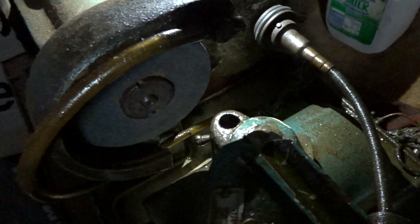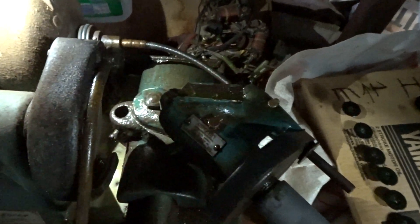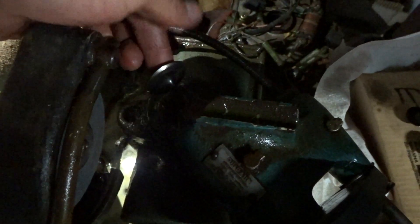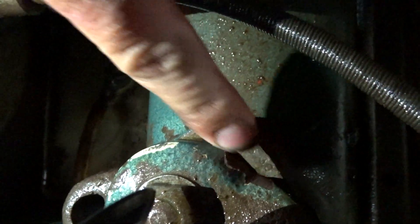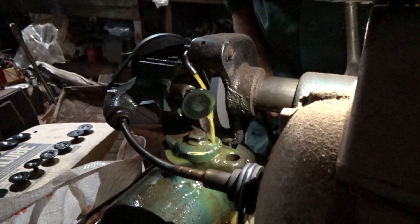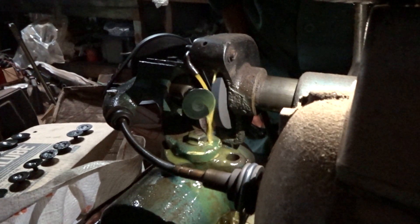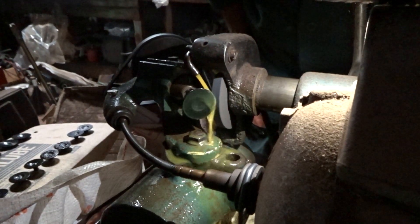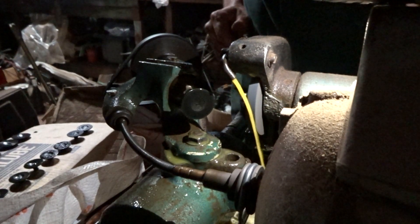What this is, is basically just a grinding stone that can move in and out, and a chuck that you put your valve in. The chuck spins in the opposite direction to the grinding stone and holds it perfectly on an axis, so you can get the exact angle that you need — we've got it set to 45 degrees. If you can hear that inconsistent noise, that means your valve face isn't concentric. So I'm going to grind this one down a little bit and have a look at it.